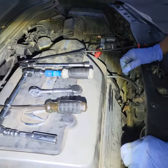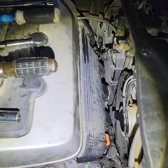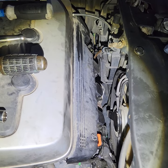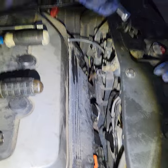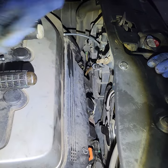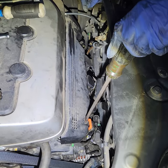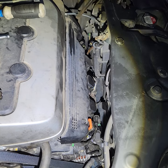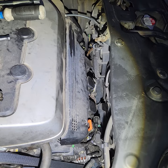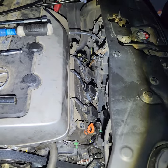As you can see here, Acura has done the wonderful job of placing the spark plugs in the most accessible spot in the vehicle — right up against the fan. We're going to take our 6mm. See this dust cover right here — go ahead and pop this off. Originally it's going to be horizontal; you turn it to the side both ways and it pops off.